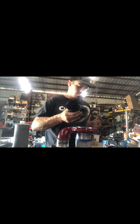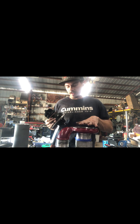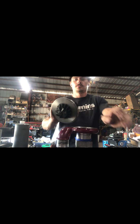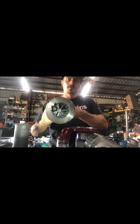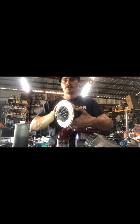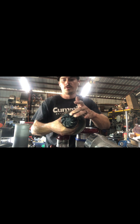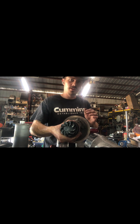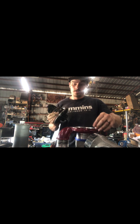This one is going to get changed to a 68 turbine and put into a 9cm housing — that's all labeled. Now this is the old SX3 top cover, this is an SX3 compressor wheel. Here's the clip on the 8074 which changes its nomenclature to 8073 — it's still an 8074, it's just clipped. It increases the flow rate usually.